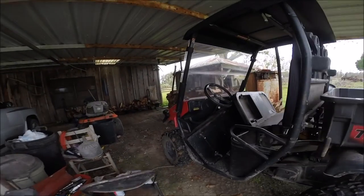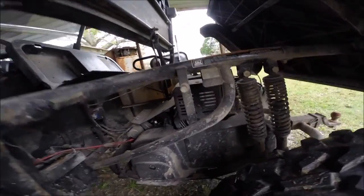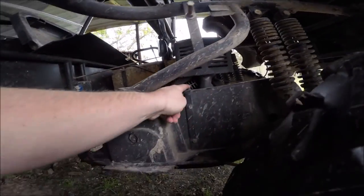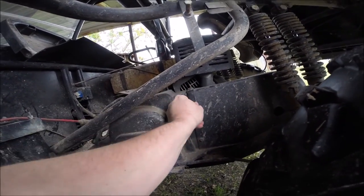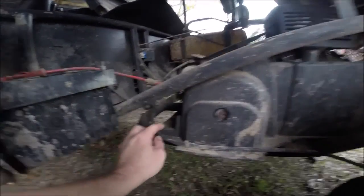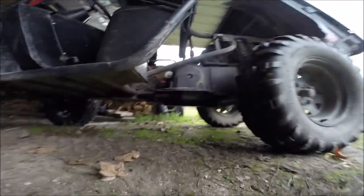Trail Wagon Honda TW 400 — we have a very loose belt, so what we're gonna do is take these two covers off. You can actually use a screwdriver here for these bolts. There's gonna be some screws along the perimeter here; we're just gonna remove those guys and go from there.